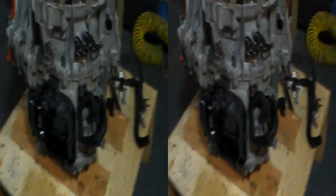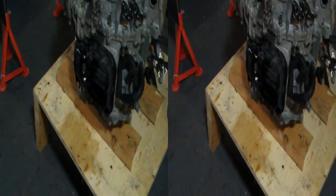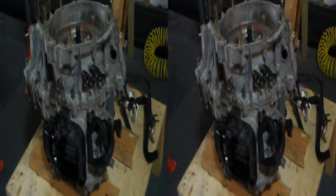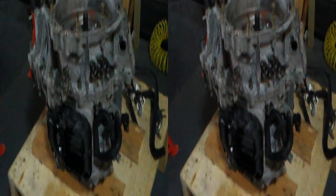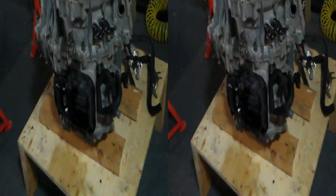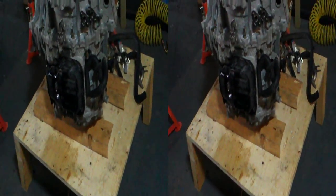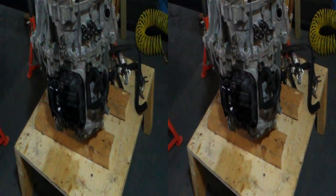There's a shaft that goes through, and there's an oil pump underneath there, which is actually sat on the shaft — and the shaft goes through to engage with the rotor of the planetary gear set, which is connected to the engine. So the engine actually pumps the oil through, so you have to have the engine running in order to get the oil going, it seems. Not sure about that.